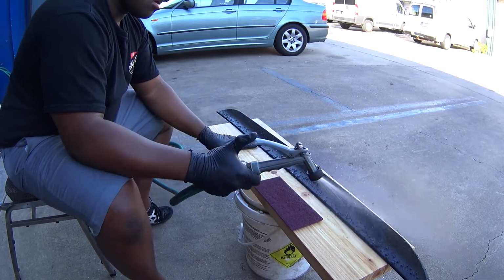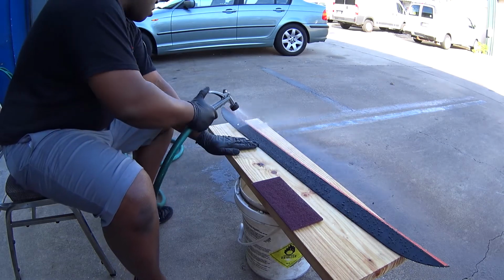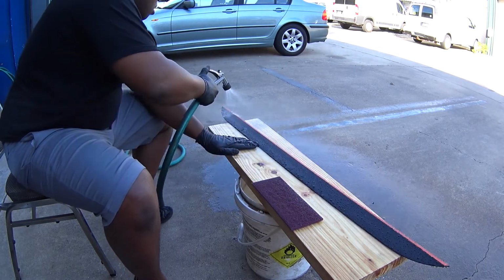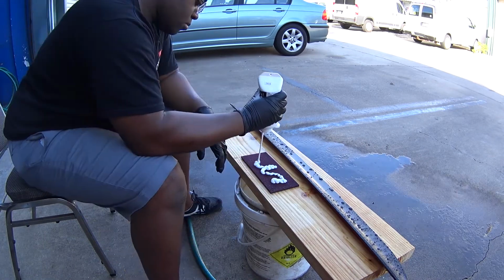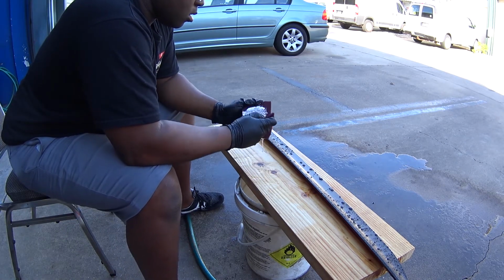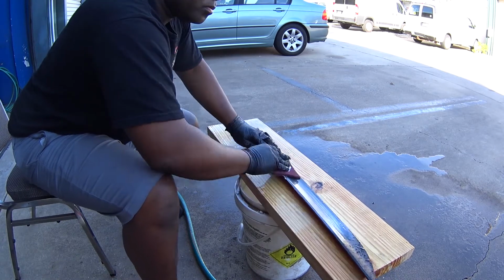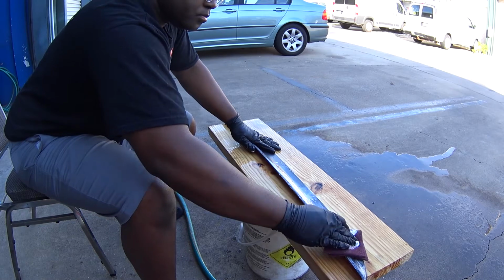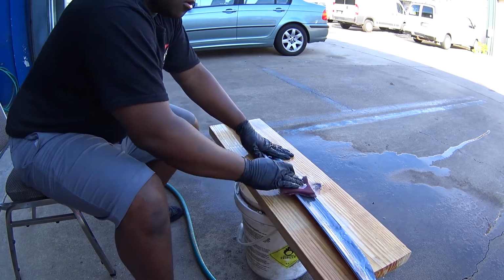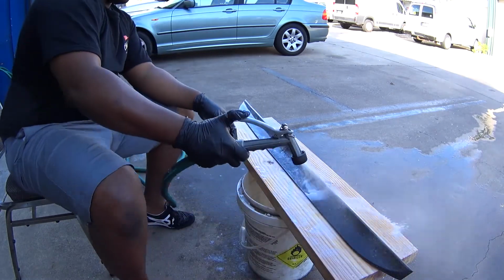Anyway, the first step in preparing the surface is to wet the spoiler to prepare it for sanding with a scuff pad. Next, use the 360 grit scuff pad with sanding paste to clean the spoiler and roughen the surface to allow the base coat to stick. You'll want to sand lengthwise so all of the scuffing lines will face the same direction. Once done scuffing, rinse with water.